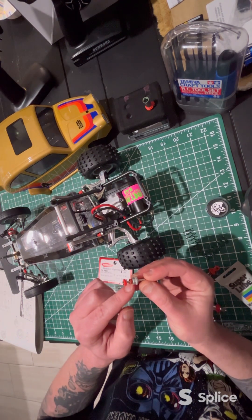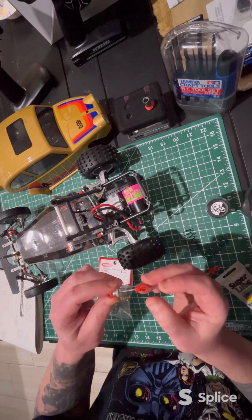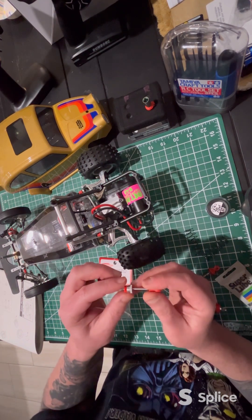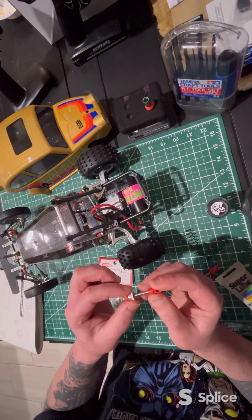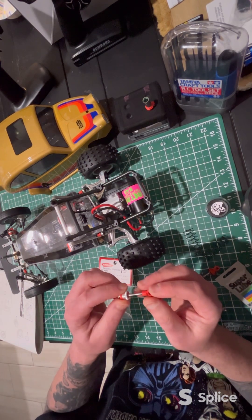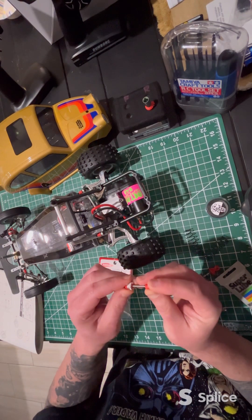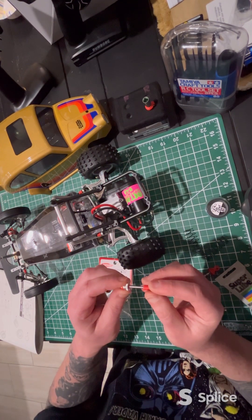I fill that up with grease and then essentially push everything down and shove in the O-ring and the whole assembly together. You'll get grease squirting out the bottom and some out the top. I also use that excess grease to lube the shaft — not a whole lot, you don't need a crazy amount. I also like to put a little bit on the threads; that helps when you go to screw it in, and it also helps seal it and keep any dirt or moisture out. I used to have really good success with that back in the day for helping with leaking shocks. There are a lot of methods out there, and I'm not saying this will fix every single leaking shock, but this has worked for me and I've had good success with it mitigating or stopping the leaking altogether.